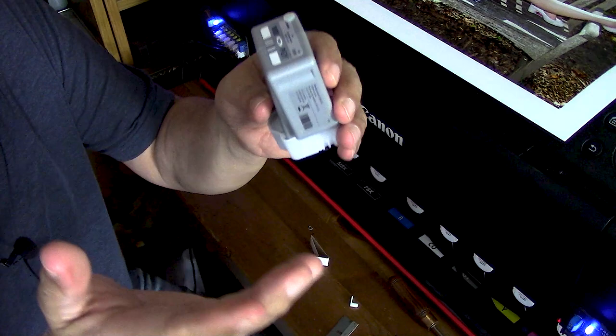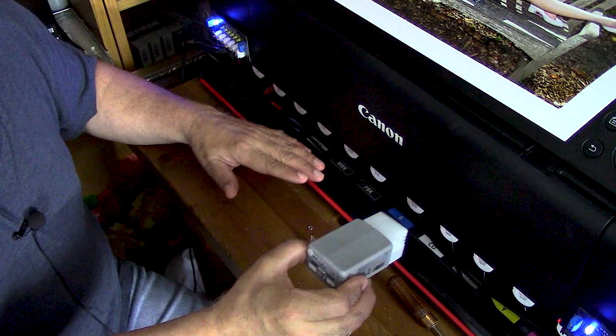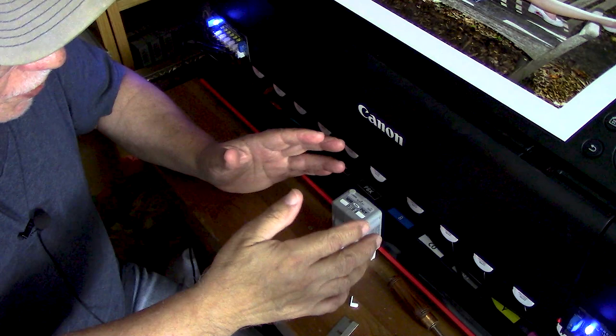The minute that light is triggered, you remove the sensor defeater. That tells the printer that you have opened this lid. Push whatever cartridge you have to exchange in, unlock it, bring it out carefully because again, you have these cables attached. And then you're gonna hold it in this orientation like so with the cable attached. You don't wanna disconnect that sensor. You wanna leave it attached.